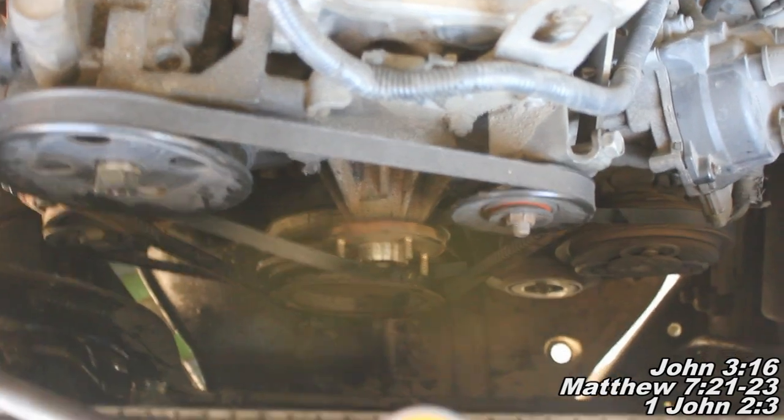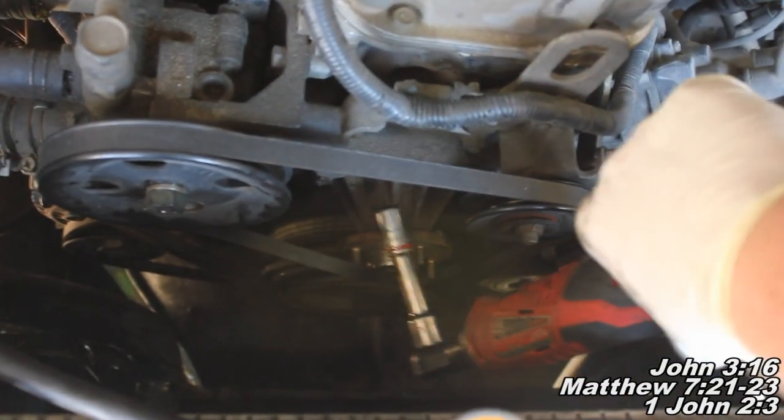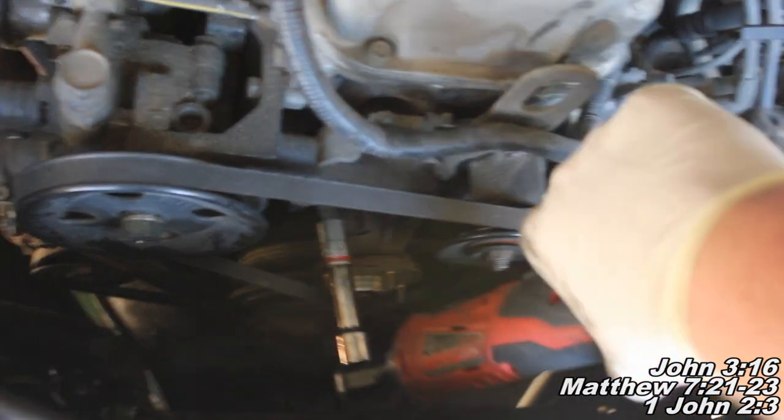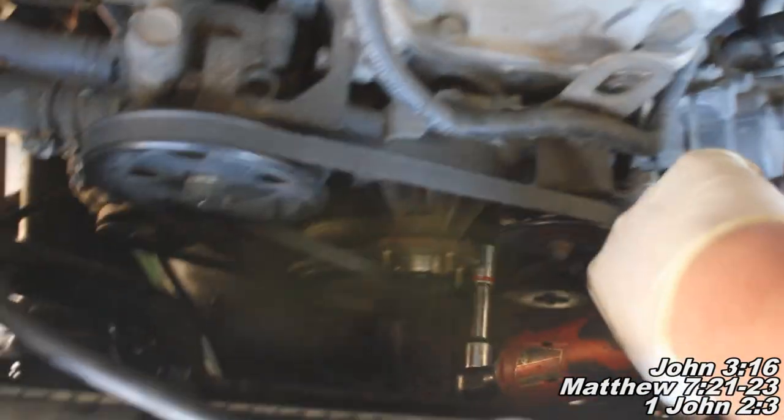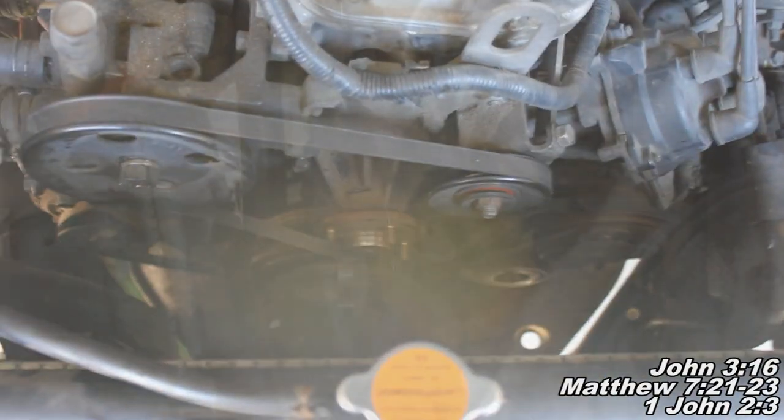Also, another quick thing I want to add there is when you pull this pulley out of your way, it's real easy to get a ratchet and extension like this, and they're 12 millimeters if I didn't already tell you that, and you just take your ratchet and you'll be able to access all five of them like this once you get that pulley out of the way.